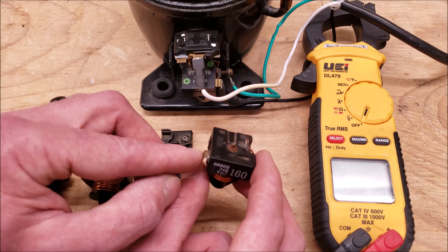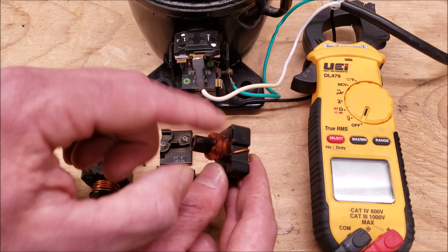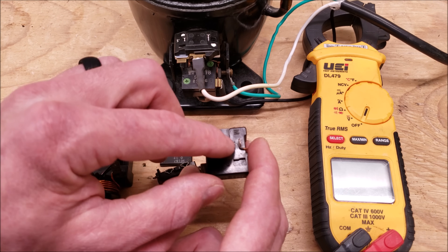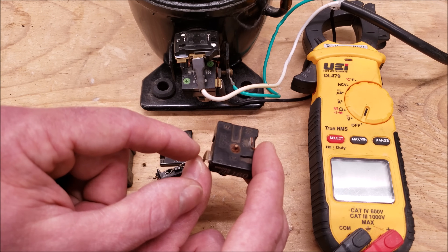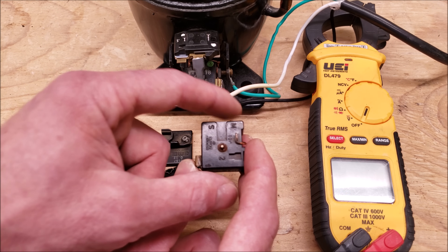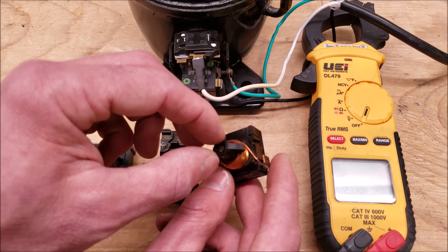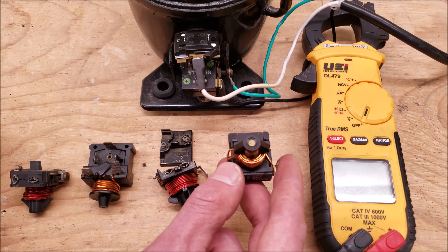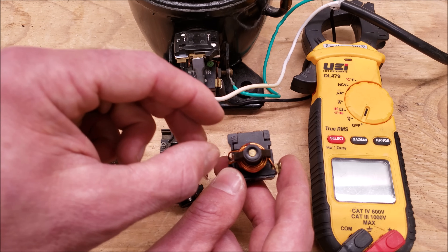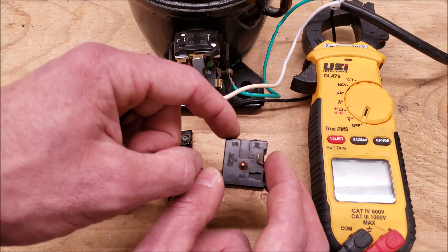Your power wire ends up going here and it follows this heavy gauge wire around and then over to here. This is the top, so this will be up. Your power wire comes in here, gets wrapped around, and then it comes out here to power the run winding. Inside you have an iron core. When you tilt it this way, these connections will actually touch — the iron core is able to fall down onto the two contacts that are inside and connect them. If it's in the upright position, they should not be connected.